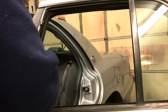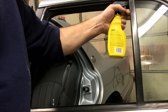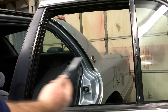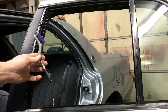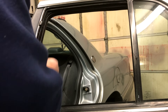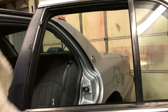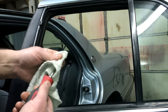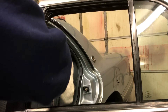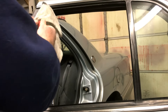Find where the glass goes up and down — you don't have to do the top, just the sides. Hold the sprayer right in there, then take your brush and brush it. What this does is loosen up any dirt in the track. Then take a shop cloth — one of your white shop towels — and a screwdriver, and run it down inside there to dry it out. It's pretty dirty.